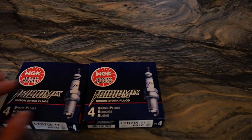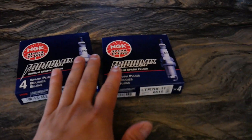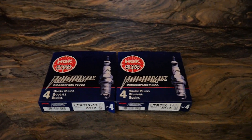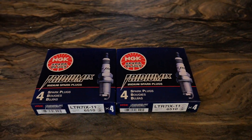With today's video, I have a few things that I want to put in my car. Today I have in store some new spark plugs. These spark plugs are cooler than the stock ones and the normal ones that Ford recommends. The reason why I'm putting cooler spark plugs is to make sure detonation doesn't occur sooner than it should.